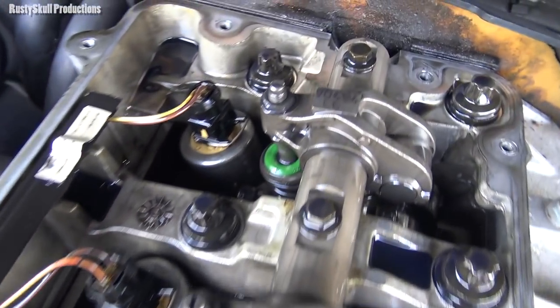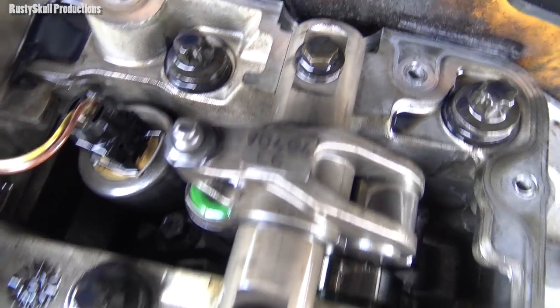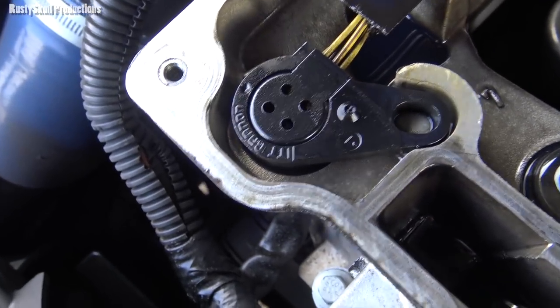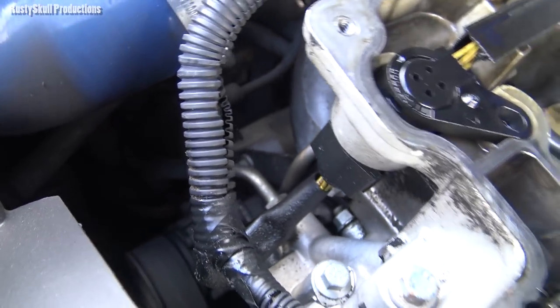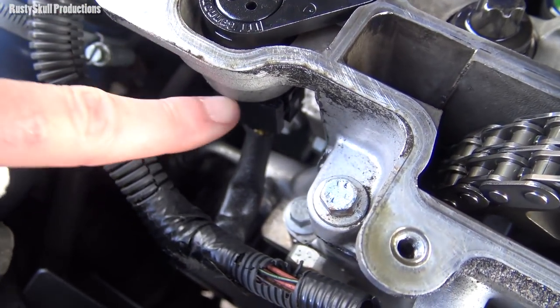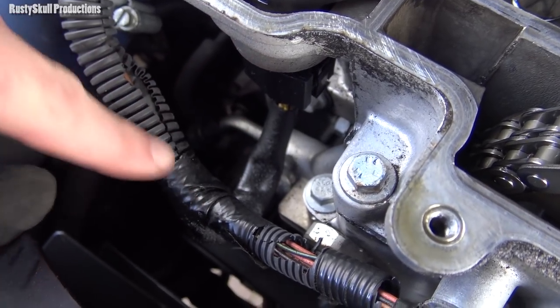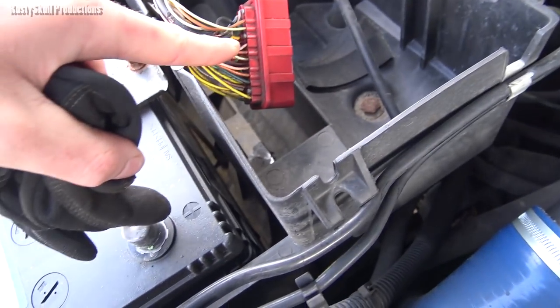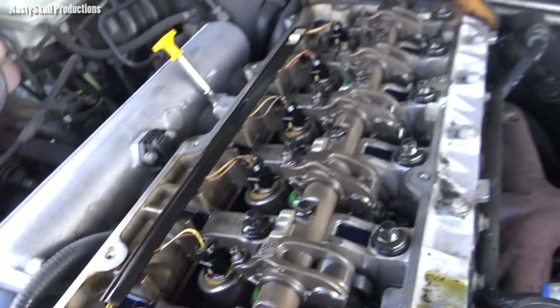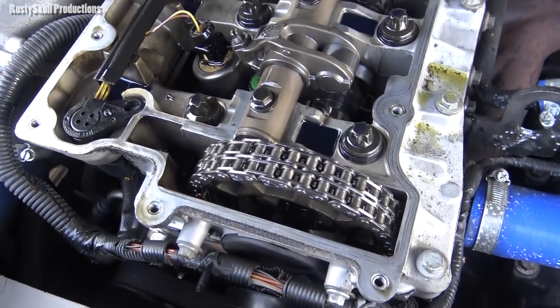I'm not quite sure why there's one different one there. Oh, it's not, it's the same. I thought it was a different one, but that's a culprit. Oil leaks through there, comes in here and around this gasket, seeps into that plug, goes down, somehow goes uphill and makes its way into this red plug. So I just need to change that now and we'll be away.